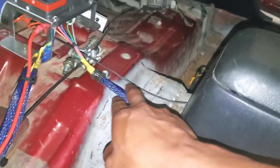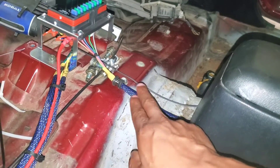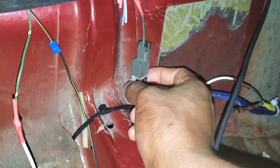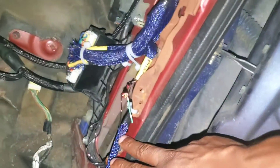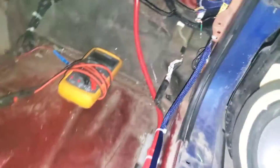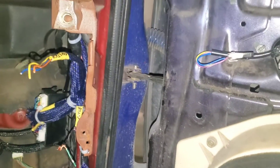This is your relay inputs — the switch that controls the relays. As I have none of the other ones hooked up, this white one is hooked up to a switch. Once this switch activates, it cuts that relay on, which sends the power to the fuel pump and the fuel pump does its thing. These are your outputs from the non-relay circuits. I only have one of those coming out, which I made — just reused one of the Nissan connectors — and it comes out here and goes into that dash harness that I have tucked away. That red battery-plus wire is where that constant is going to. It's a very small wire and it doesn't short the system or anything.